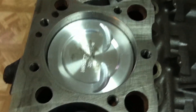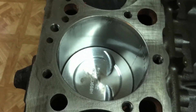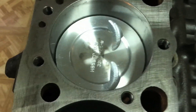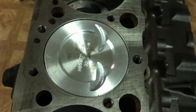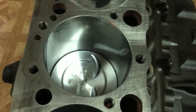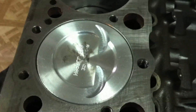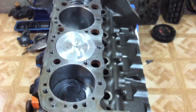And it starts all over. Your intake valve opens, piston moves down to 10 times the volume - or whichever compression you have - that is your intake stroke. The crank continues to turn, piston moves back up, compresses the air and fuel - that is your compression stroke, stroke number 2. Spark plug fires, burns the air and fuel mixture, expanding gases push the piston back down - that makes your power, that is your power stroke, stroke number 3. Then the piston moves back up, exhaust valve opens, and the piston pushes all the burned gases out of the engine. And that is a 4-stroke internal combustion engine and compression ratio.